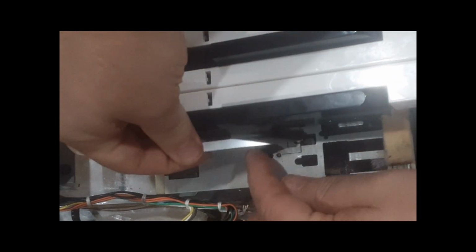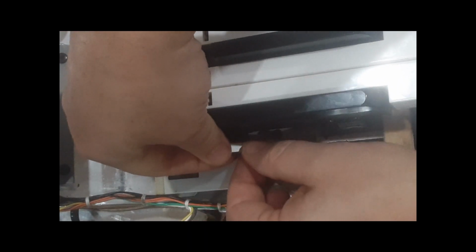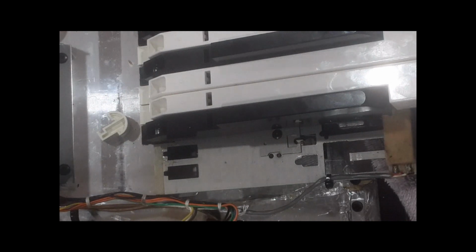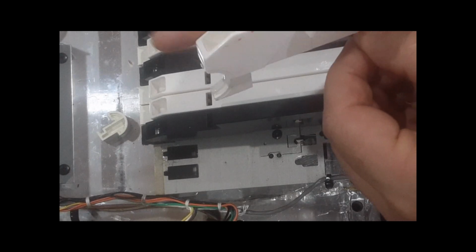And if this spring does fly out through there, relax, pull the key off carefully. Don't mess with the spring, and slide the spring out. Don't bend it because you'll bend the switch. The switches are delicate, so check your switch first. End piece is easy. Now I can show you exactly what we're doing in the middle.